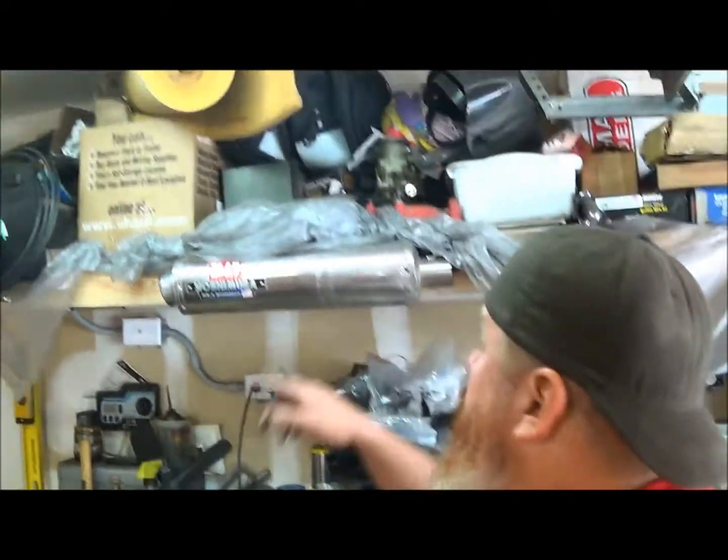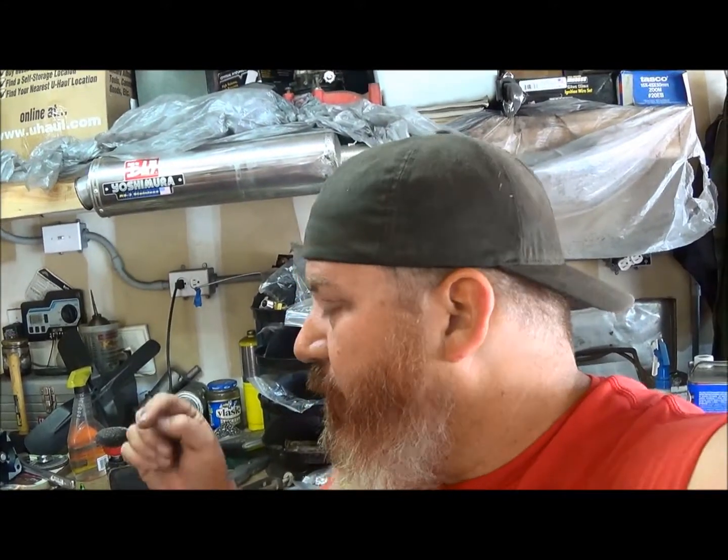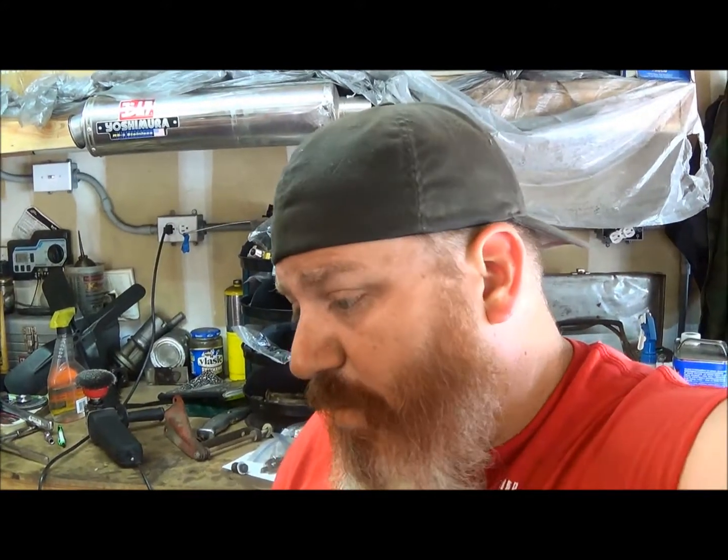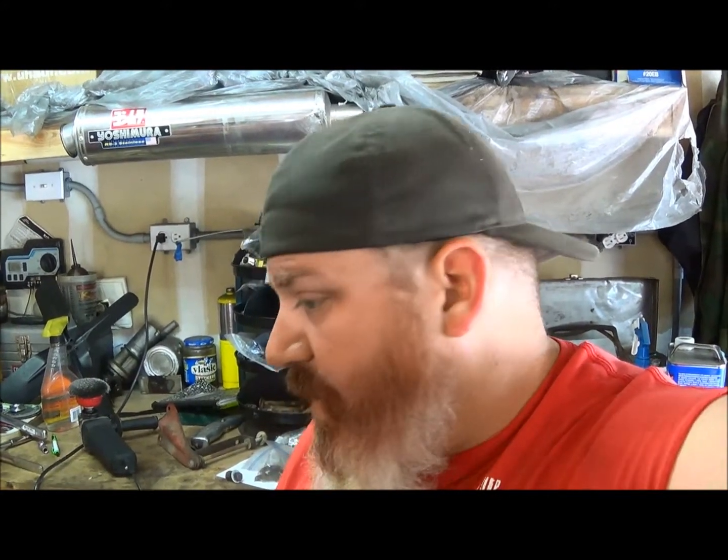The big hold up now as far as firing it is I might run it off the two-barrel for now until I can find the right four-barrel carburetor. The four-barrel I had is a factory Thunderbird carburetor - I think the base is warped and I don't really want to mess with that because I hate vacuum leaks. So I may just run it off the two-barrel for now until I find a good four-barrel. The intake swap isn't that difficult, especially in an engine compartment like this where you can reach everything.